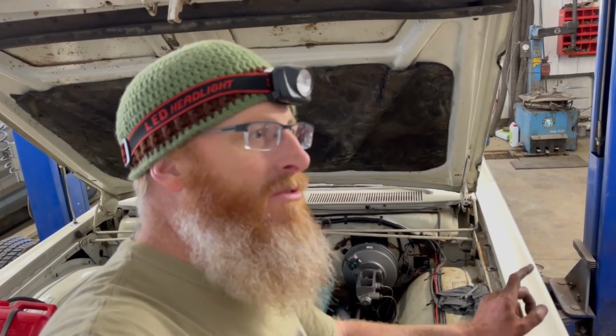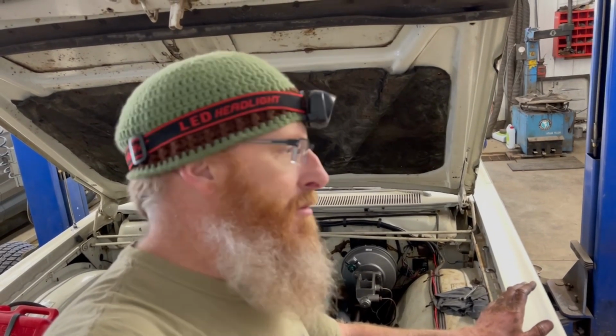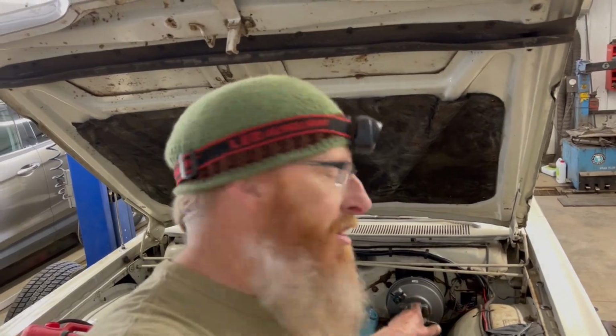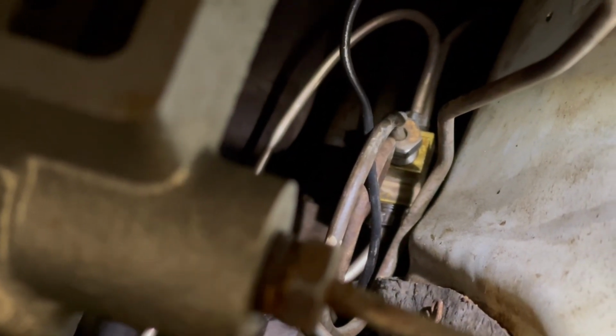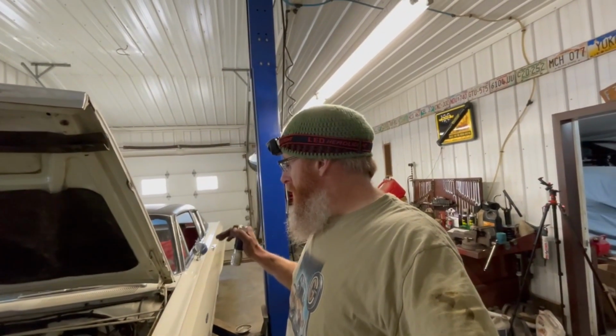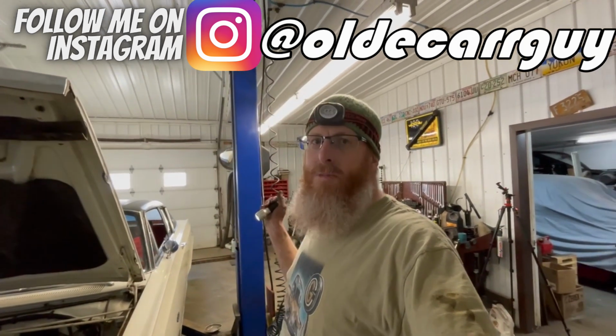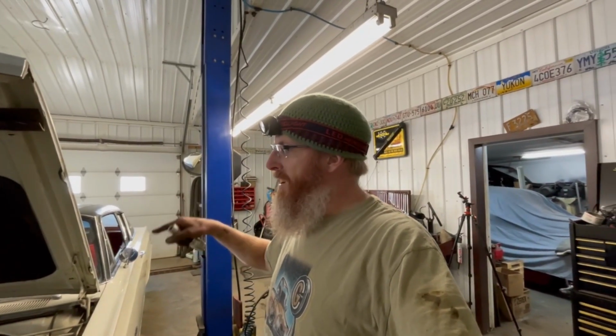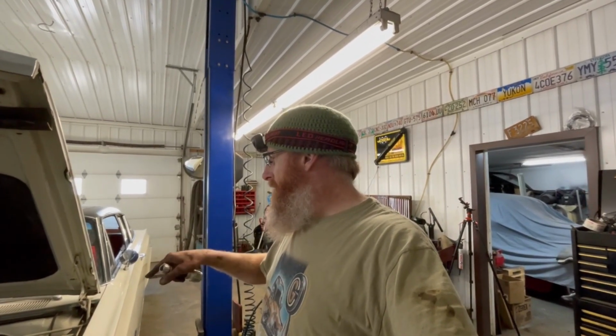So I'm glad I don't have to deal with these brake lines anymore. I know that my father did a majority of the work, but what little bit I did was a pain in the ass. Anyway, we're getting ready to add brake fluid to the reservoir. All the lines are run to the distribution block. They're all tight, I hope. And as long as the flares that I put on are done correctly, which I think they are, we should be able just to add some fluid, and we'll start using our pneumatic brake bleeder to draw all the fluid to the lines, and then I'll have to recruit somebody to do the fine tuning inside with pressing on the pedal. So we're gonna get that done and see how far we can get bleeding these brakes.